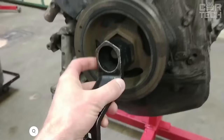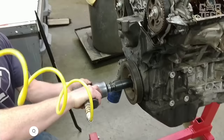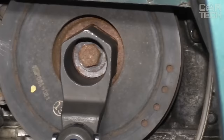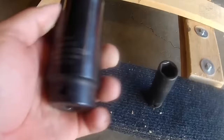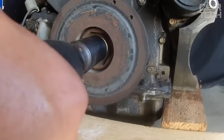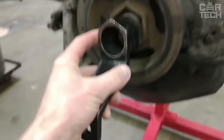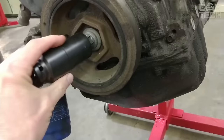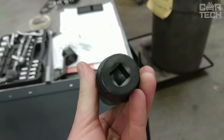Toolset for crankshaft pulley removal from B-Tool, includes a 50mm diameter pulley puller and a 19mm socket nozzle for the crankshaft damper bolt. The puller secures the crankshaft pulley, preventing it from turning when the bolt is loosened. It fits many Honda and Acura engines. The 19mm bit is used for crankshaft damper bolts with this hex size, and tools are used with a ½-inch wrench. The deep counterweight reduces force and increases torque, making it easy to loosen even the tightest bolts. Made of durable alloy steel with a black coating that protects against corrosion.